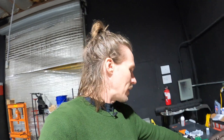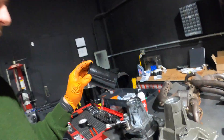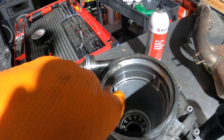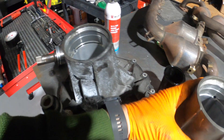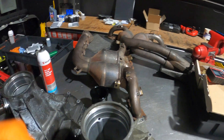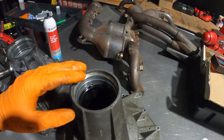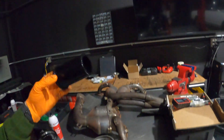You may be thinking: why not just get these from Getrag for the older cars? This actually won't work in the FF. If you look in here, you can see the GTC4 Lusso has a little groove and this lip has been ground down, giving a wider hole. Compare that to the FF — it has a very short hole with no groove. So if you put the Getrag cone inside the FF case, it doesn't drop into place, you can't seat the bearing, and it's not touching the bearing on the other end. It simply will not work.